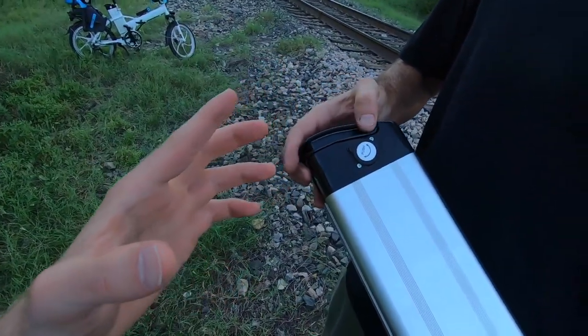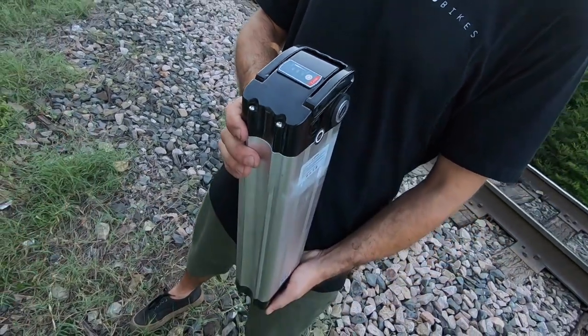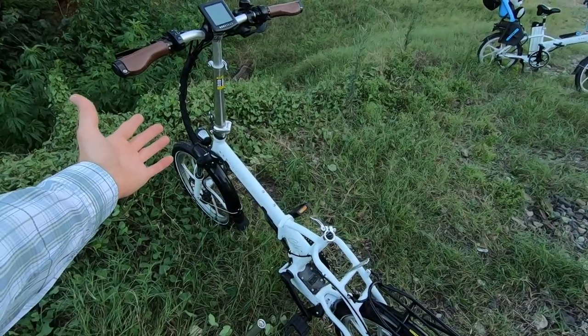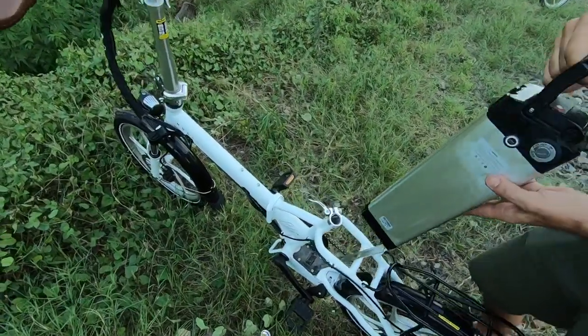There's a charging port — I love that the charger has a metal end piece, it's a little more sturdy. It's a two-amp charger, so about five and a half to six hours to fill this, but the charger is lightweight at about 1.5 pounds, very compact and easy to toss in a bag. There's a little LED charge level indicator built right into the top of the pack. Don't drop it, avoid extreme cold, and especially avoid extreme heat. Take good care of the battery pack. If it ever fails, they sell replacements — they have an 18-month comprehensive warranty. This battery isn't proprietary either, so you could go to a company like FTH Power for repacking. It's a pretty safe long-term choice.